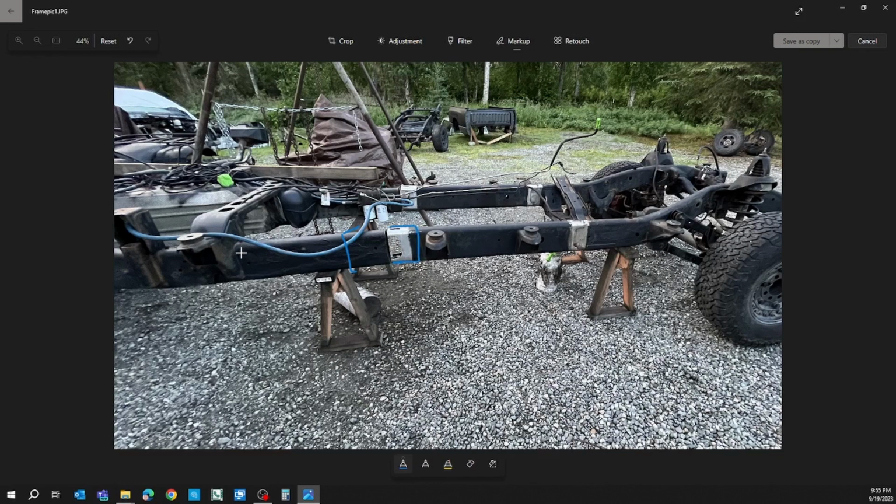So there you have it. I mean, overall you need about 20 inches of extension of this part of the frame to keep with the rear section to slide it together to get your measurements. So you need a minimum, I would say, of 24 inches there to there to make sure once it's slotted inside the expanded section at the frame splice, or the factory splice, that you have enough material going into the next section of frame and you will still meet your measurements for whatever you have when you're measuring. So there you have it. Those are the measurements I used. That's how I came to get mine all lined up and set up.